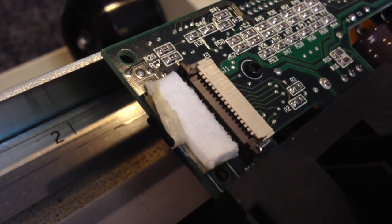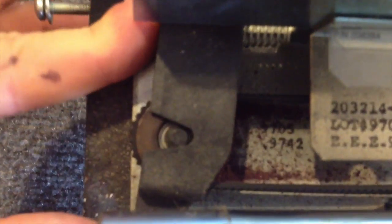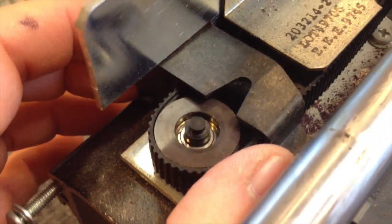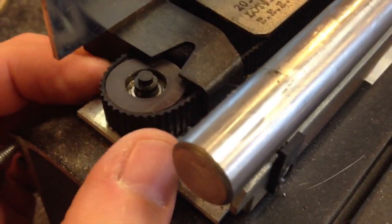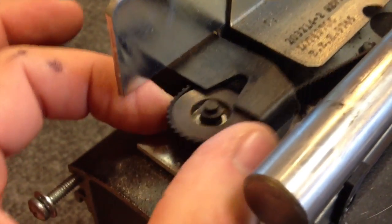All of these connectors are done by pulling the little tabs out and then peeling the cable away from the double-sided tape very carefully until the cable comes free. Get yourself some 3M double-sided sponge tape to replace that piece once you've got it removed. This is the belt pulley tensioner — push it in with your left hand, slide it forward so it unlatches from that little edge down there, and it goes completely slack. You can pull the screw spring out and work the pulley away from the belt. You actually have to take this whole gizmo out and set it aside so you can move the carriage assembly down the rod and off the end.